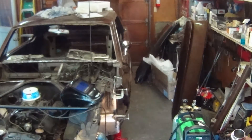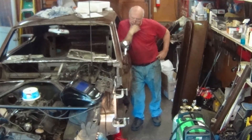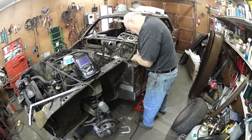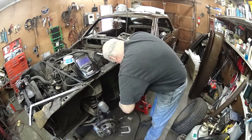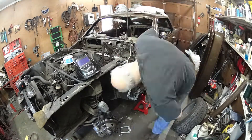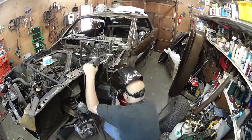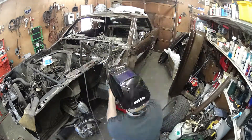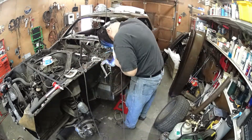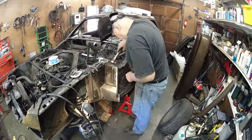A lot of thought goes into this — I get worried that I'm about to do something permanent and need to make sure I'm doing the right thing. Now I'm drilling the holes for the plug welds. I've made up my mind — it's going in. You'll notice I take the weight off the jack stand under the A-pillar. I had to put this corner under tension because when I welded in the torque box, the hydraulic jack was losing pressure and I ended up with an eighth inch of droop on that left apron. So I put it under tension with the weight of the motor just before I weld the stiffener to the torque box.